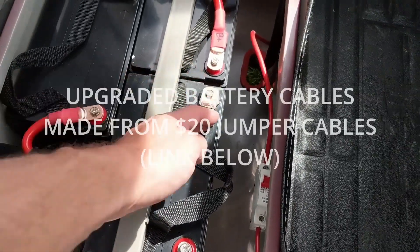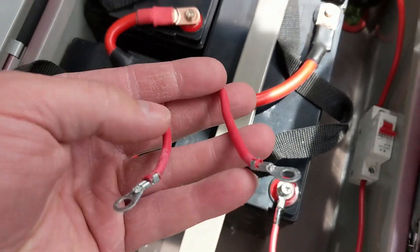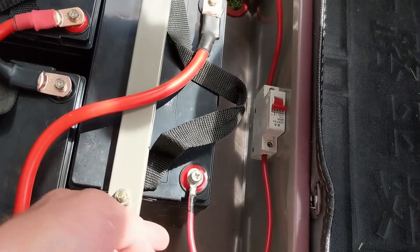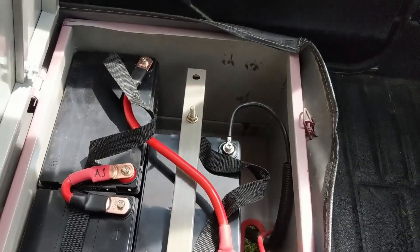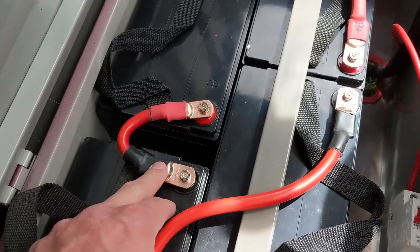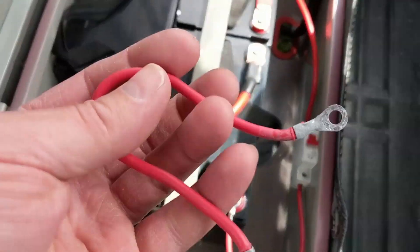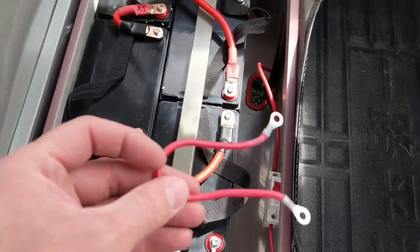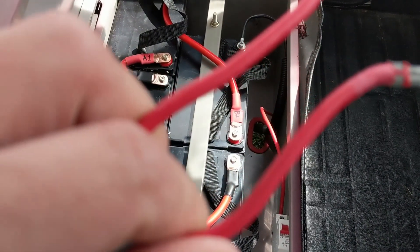I made my own battery leads. Here are the stock ones — I wanted to leave them in here for you to see. The stock ones are like maybe 12 gauge wire, and the main leads that go to the car might be 10 gauge. China doesn't actually use American wire gauge for their wires anyway. I'll link in the description if you want to make some big fatty leads like this — you can make smaller ones, but I would use at least 10 gauge wire. It's really a bad idea that they use smaller wire in between. You're really limited by the smallest wire gauge you're using. These ones don't look like they're melted or anything, so maybe they're fine.